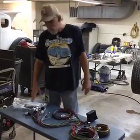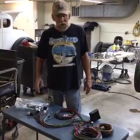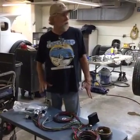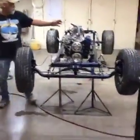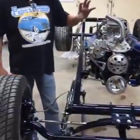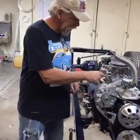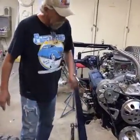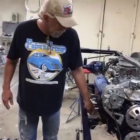And I think it even says it in the directions, if it's 100 amp, don't do it. If it's 80 amp, you can. I say don't do it no matter what. Normally we do an alternator that would be a low mount over here. Run your wire by itself, separate, run it clean, run it down, however we're going to run it, and you can connect this alternator directly to your battery wire right here.